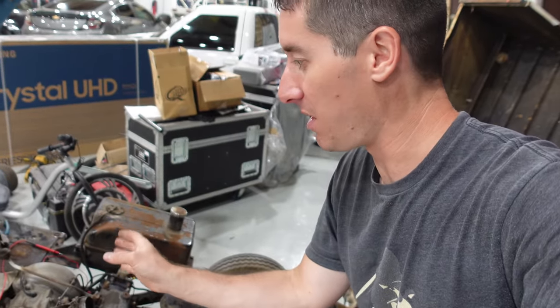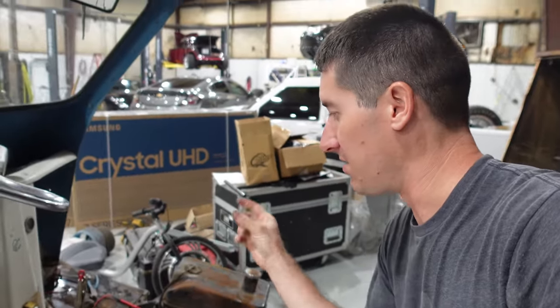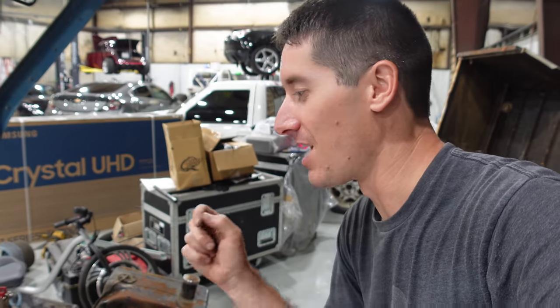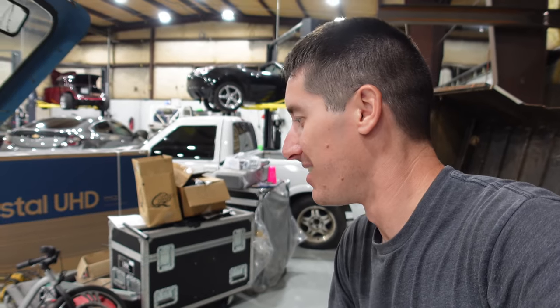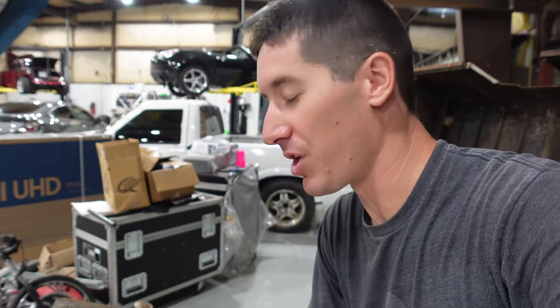It had power before, but it was just a rotten old wire. Also, for some reason the fuel gauge was running off the coil — it makes sense, it was a good place to pick up 12 volts — but I really wish they had just wired it straight to the ignition switch. After all that work I was like, these points are still garbage. So I went to O'Reilly's and did 30 minutes of research, comparing Vintage Golf Parts with every cross-reference I could find. Everybody said that this engine specifically — a 66D, not the Columbia that came later — all the way up until around 1970, this part doesn't exist. I tried every set of points they had in the store. Nothing comes close. So I took the points back out, used a die grinder with a wire wheel, and polished them. They're not better honestly — they're pitted, they're junk, and fully irreplaceable.